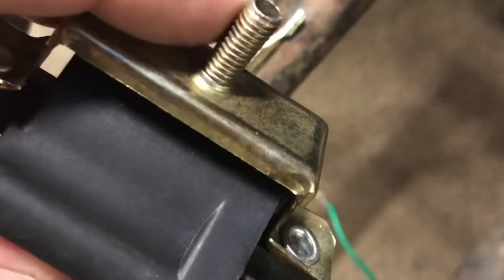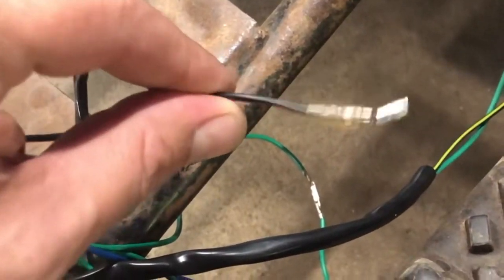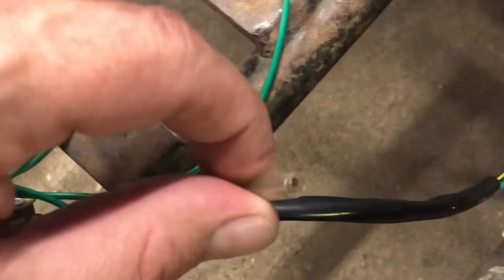The red and green that come out normally plug into your CDI. You're going to remove them from the CDI and plug them into the blue and white and the green on the new spark box. Mount it where the other one mounted so it's grounded to the system. With all of that grounded down you will have a running engine. I'll also show you what wire I tap into to get 12 volts — but to test it: 12 volts and ground on your battery, and your ignition red and ignition green.